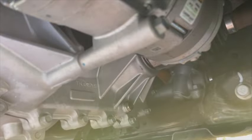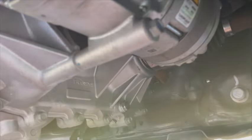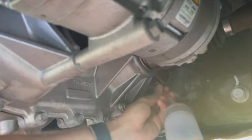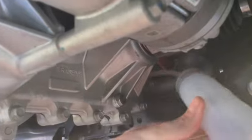The reduction gear will take a little bit more than a U.S. quart to fill up — that's around 1,000 milliliters. You'll know when it's almost full because some oil will start dripping out from the fill plug. As soon as oil starts dripping out, I always put a little bit more in just to make sure it's really topped off.